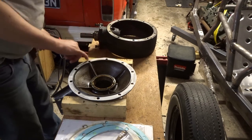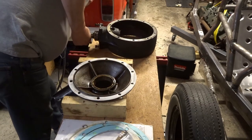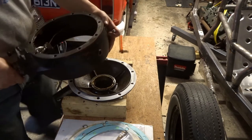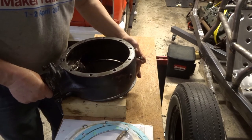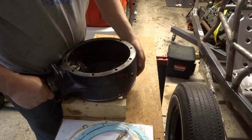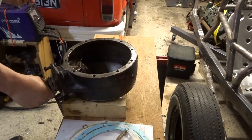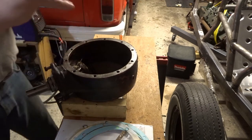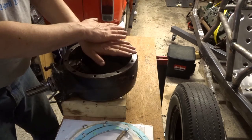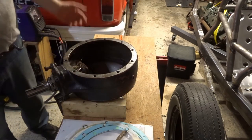I've got a light and my two marks are there by this hole, so I'll just get that lined up. Let's check the marks on the case - there they are. What I found is if you put it on at a bit of an angle like that and get this bolt to start to turn, just checking my marks are still aligned - yes - when you then drop it down properly and the two kind of interlock it's in the right place. If you try and twist it around because your holes are misaligned you risk having the gasket in the wrong place. If you get one bolt in there before you drop it down all the way, the others will all line up fine. Here's my nice ring of bolts.